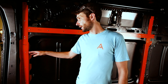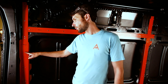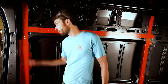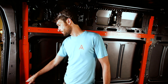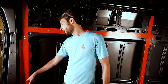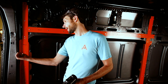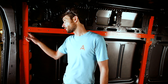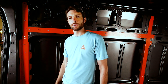One thing we forgot to film on TH2 — the aft piece on the driver's side — is where the cinch nuts or PEM nuts are. Before you set this piece permanently, you need to get behind there with a step bit and drill out the van body. That's not for the PEM nut itself; it's for when the bolt goes through the track and into that PEM nut — it needs somewhere to go before it hits the van body. So before you set all the rivnuts, go in there and drill an access hole for the end of the bolt.